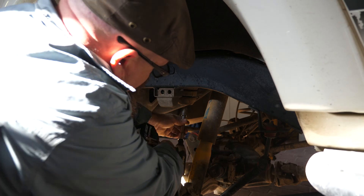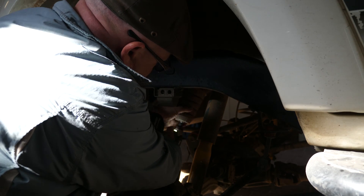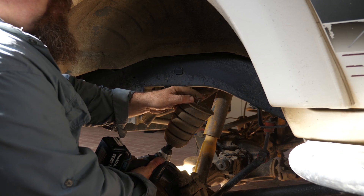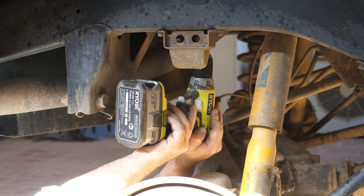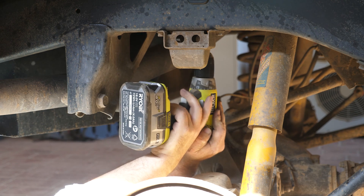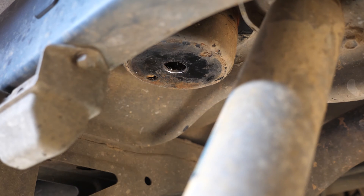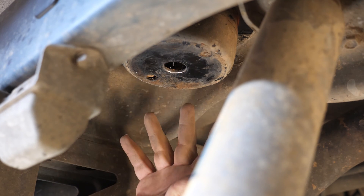Now the coil spring has been removed, we have to remove the bump stop spacer — that's a 12 mil socket. They come out reasonably easily. Now we've removed the bump stop, we have to drill in the top a 25 to 30 mil hole where the screw goes through. We'll increase this hole to about 25 to 30 mil, starting by getting rid of the captive nut with a 10 mil drill bit. That looks to be about 26 mil inside. Just need to make sure all these edges are nice and clean, so we'll get our file out and clean it up.